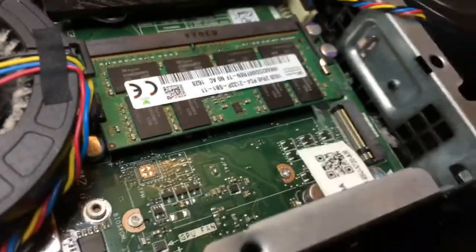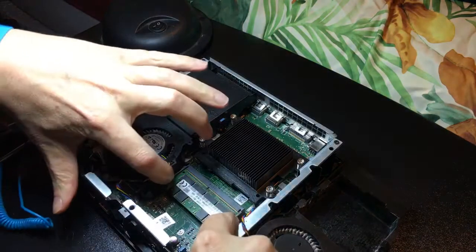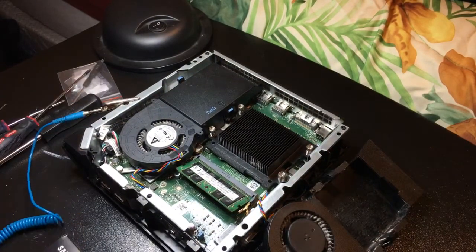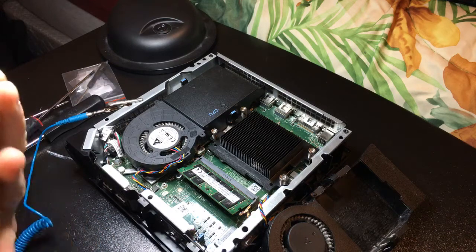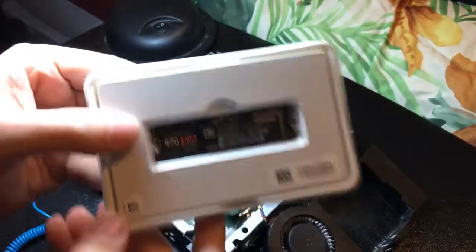You can see there's some RAM right here. I need to pull that RAM out, and then right in this spot is where we're going to put the new drive — it's going to screw into that hole. To remove the RAM, pop the two sides and it will pop up at 45 degrees. You can leave it in there, which is what I'm going to do, or pull it out and put it somewhere safe. Leaving it in gave me just enough extra room to slide the drive into that spot. Now let me open up this drive — a really cool drive I got for my birthday from my wife and my youngest son. There it is — awesome little drive.